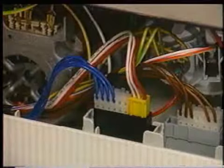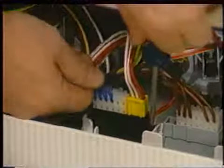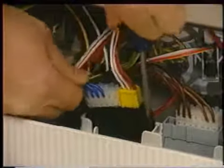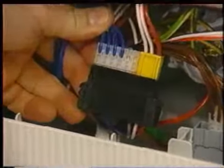To remove the wiring connectors, insert a small regular tip screwdriver along the connector side. Press in on the locking tab, moving that corner up. Now unlock the opposite corner and then slide the connector out from its housing. Located between the two heater terminals is the flow switch. In the event that water does not flow across the heating element, the flow switch will disable the element. To remove the flow switch, bring the bottom of the switch out from its base, unhook the side tabs, and then lift the switch out.